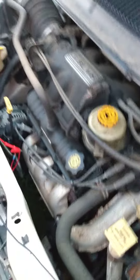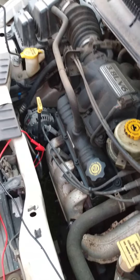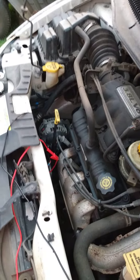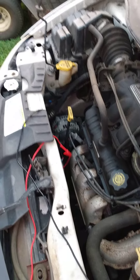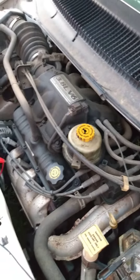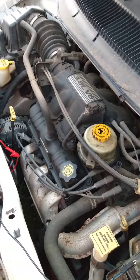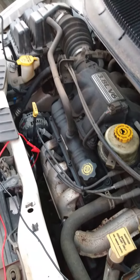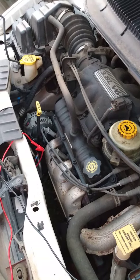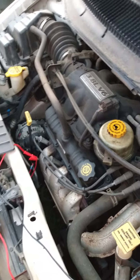So that's an easy way to test these Chrysler Dodge alternators that are controlled by your PCM. They're found on most any Chrysler Dodge Plymouth vehicle from mid-90s on up, maybe even early 90s. This one is a 2003 Chrysler Town & Country, but they're all pretty much the same. They've got one big terminal for the battery and one small plug that has two wires. Those are the two wires that you're connecting to battery voltage and ground with this test. That's it.